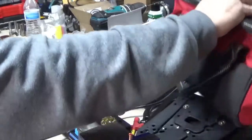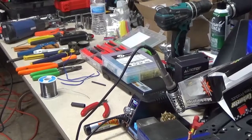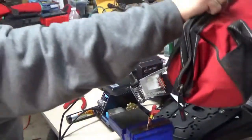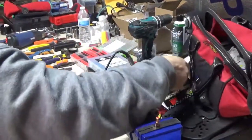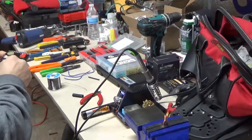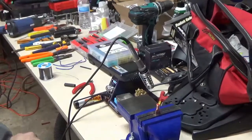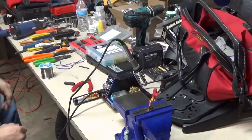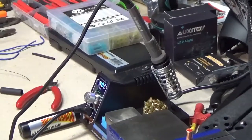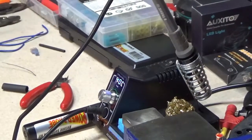Let me grab my bag. I have a digital soldering iron — do you need a digital soldering iron? No, you do not. You can buy some cheaper ones. Digital soldering irons are nice because I can control the temperature. Anywhere between 350 and 400 degrees is what I use to solder copper wires together. There's a temperature gauge on here — I've got it set to exactly 400.